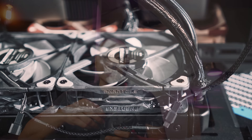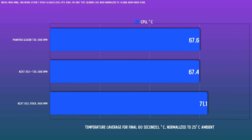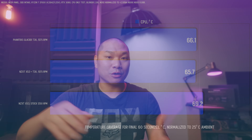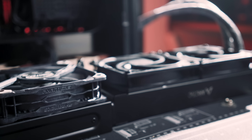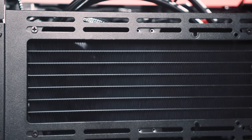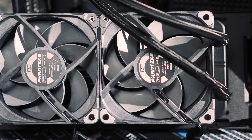So what's doing the heavy lifting — is it the thick rad or is it the fans? Easy to test. Let's throw the same fans on the X53 at the same tested RPMs. With the same fans, performance in a case at both levels is pretty much indistinguishable. That doesn't mean the thicker rad isn't doing anything, but it indicates that the fans are basically the driving force, and they usually are for most liquid cooling setups. One thing to keep in mind: in many cases the thicker you go overall, the more choked off your airflow is going to get. With the NR200, that right-side fan on the rad panel inches closer to the power supply shroud as you go thicker, so while a thicker rad isn't necessarily bad, if extra thickness causes a choke point, it might cancel out the efficacy.